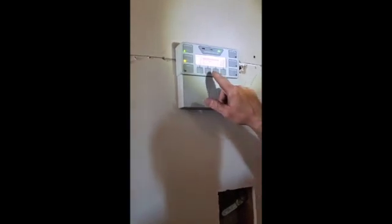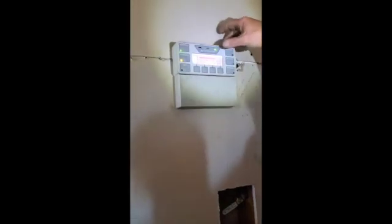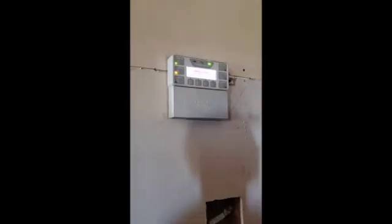We're at 51.2 right now. Everything's working good. The inverter's on. Everything's green. That means we got full power. You can see the sun is in its fullness right now. So you can't get any more out of the sun right now than what we're getting in order to bring solar into the batteries, which goes through our Outback system here, the generator inverter, which then changes it into electricity, in which we draw from our sub panel.